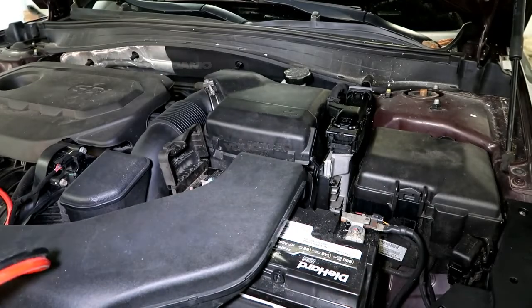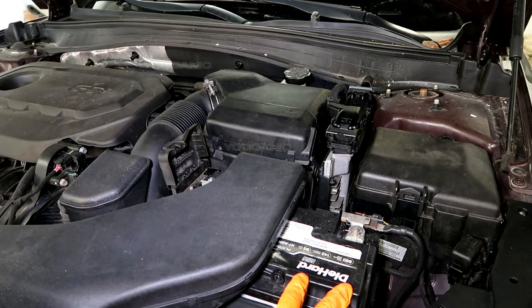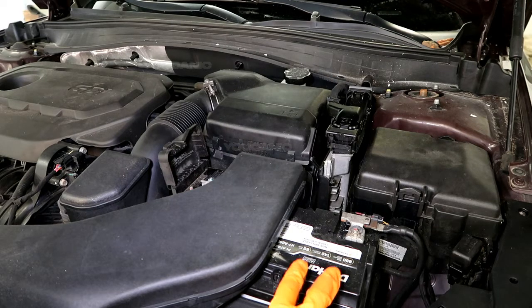Once it's started, you'll want to go and get the battery tested. If this happens more than once, see if your battery has gotten weak or is out of its lifespan — if so, you'll need to replace it. That's how you jump start your vehicle and check the voltage in your 2016 Kia Optima. Thanks for watching Ucanic, where you can be the mechanic.